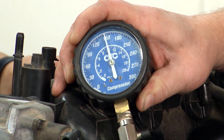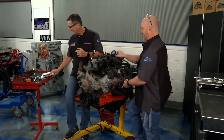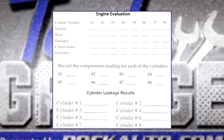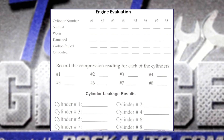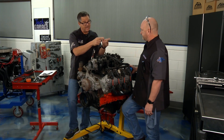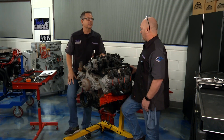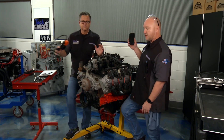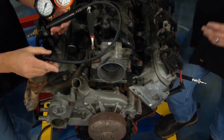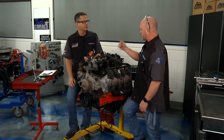148, 149, 150 — awesome, and it's good to know. We got this motor out of a junkyard and were told it was rebuilt, but we don't trust that. You can see the graphic right there — you actually get this engine evaluation form. You want to put everything on there: the compression readings, the spark plugs, everything. That's going to lead us in the right direction when we tear it down. Makes all the difference in the world to document as you go. Another tip: use your phone, do a little video recording. Also capture that data to refer to later. Take pictures along the way — it's going to be an awesome project.